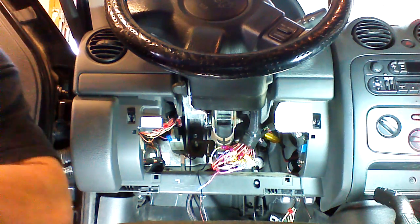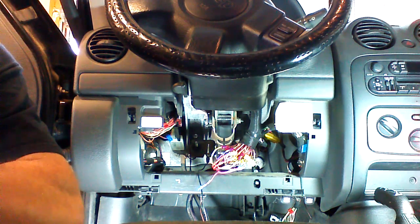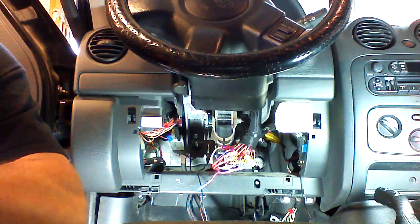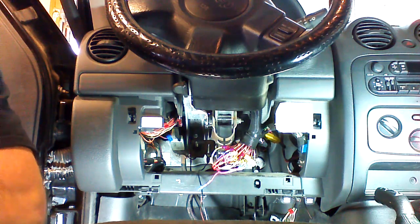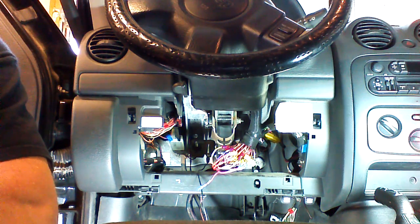Okay, so as far as the OEM remote activation goes, the 2003 and the 2004 will need the optional relay installed in order to get this 3-press remote start. The 2005, 6, and 7 can be activated through data and do not require the optional relay. If it's done through data, locking the doors from the switch 3 times will not trigger remote start. So on the 5, 6, and 7, locking the doors is not going to trigger the remote start. That will only happen on the 3 and the 4.